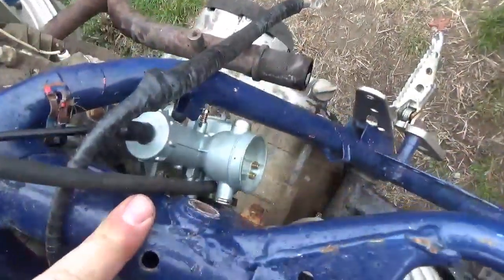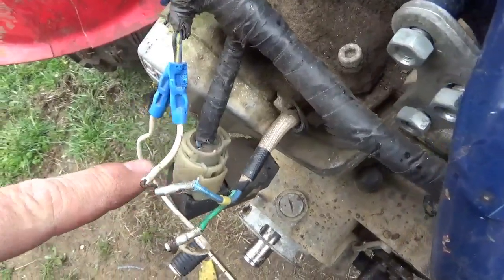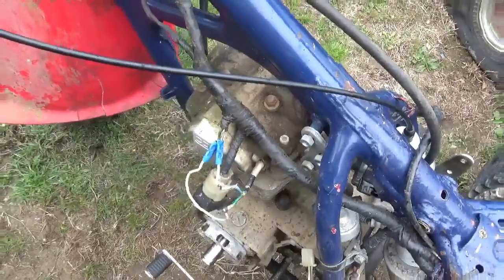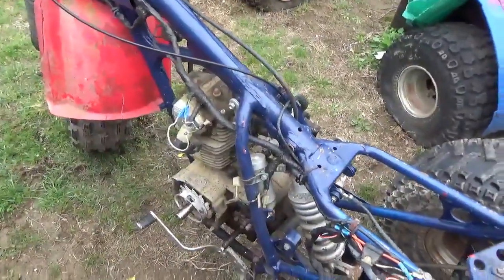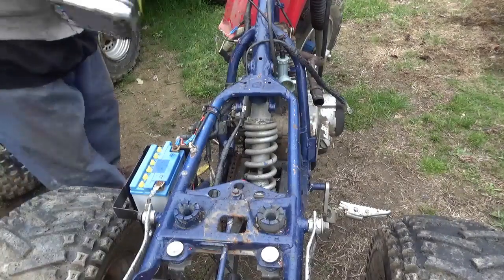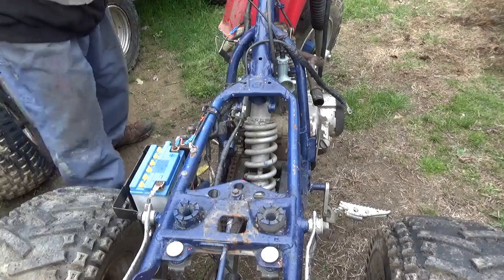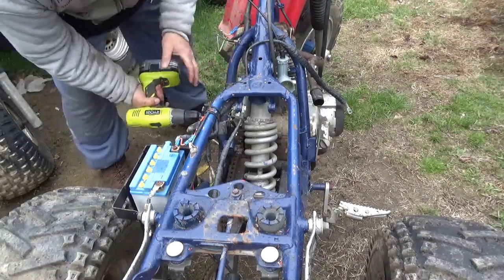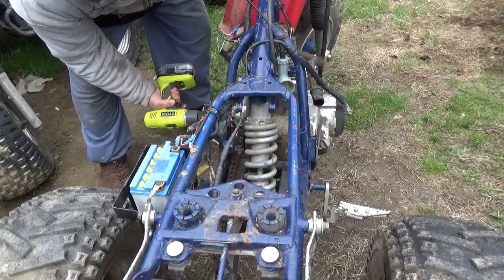So here we are. I smashed the carburetor onto it. You guys can see this is some real debatable wiring. But it does seem to be sparking. By the way, these round plug CDIs for Honda, really good. Now what I want to do is see if we can't get this thing started up. I'm going to use the drill and this really sketchy throttle and all. We'll see. Okay, I put some gas into the carburetor. Put the bigger battery on the fuel pack. It's the wrong way. It looks like the right way. Choke is on. See what happens.